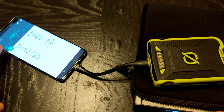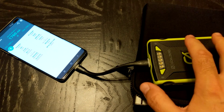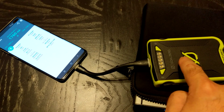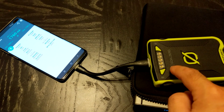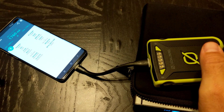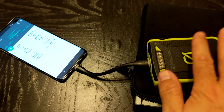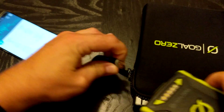When it's flashing quickly like this, that means it's charging at a fast rate. Sure enough, let's see the measurement — it jumps back up to about 1750 milliamps, so 7 to 8 watts charging output. When I put charge into this unit it takes around 10 watts, so in pass-through charging it's probably sending all circuitry through to the phone, unless there's excess capacity to store.